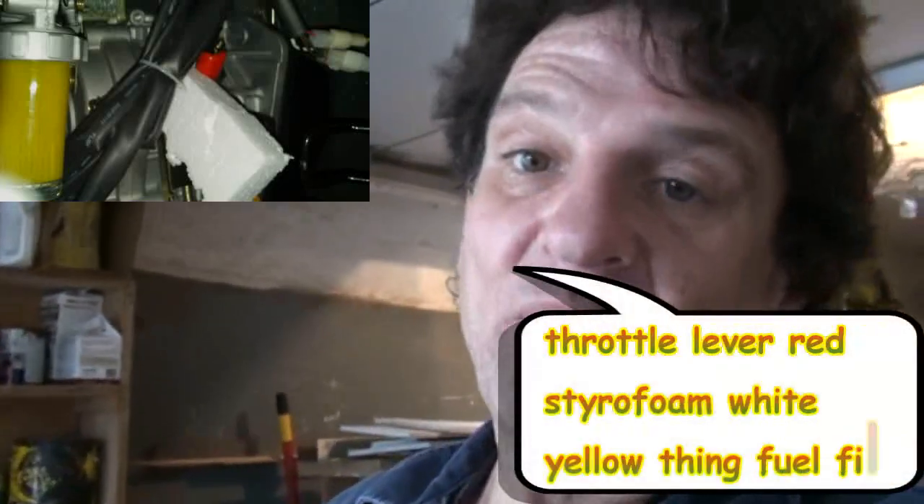After that hour and a half at lower RPM, we brought it up to 3600 RPM for the remainder of the break-in, although at certain times I'd cock it back with my fingers and hold the RPMs low — around 1300-1500 — for a minute, then bring it back up, just to give some flexibility to the engine. We've run it eight hours and three minutes on natural diesel engine oil and now we're doing our first oil change, replacing with synthetic.